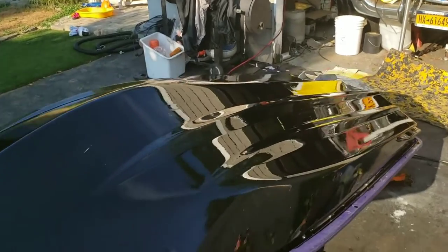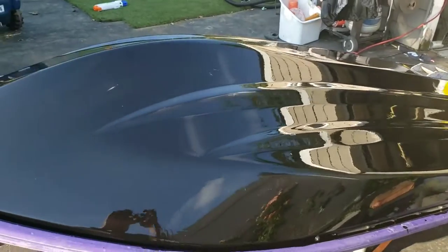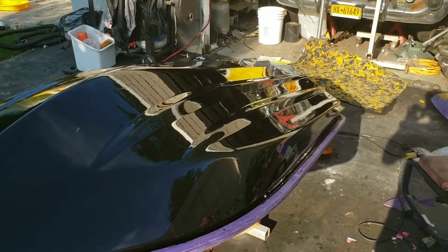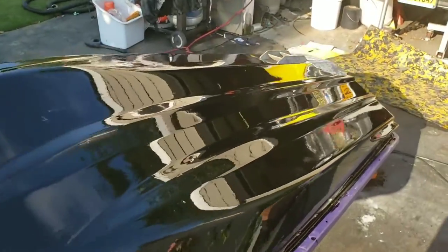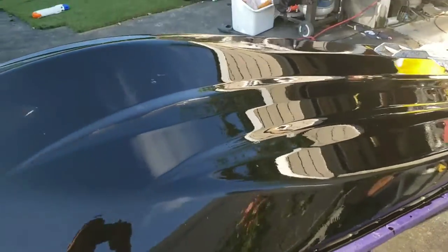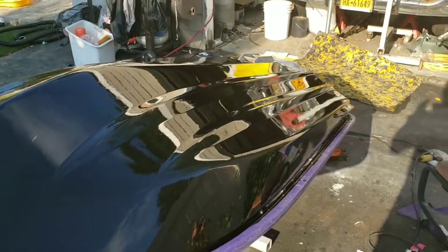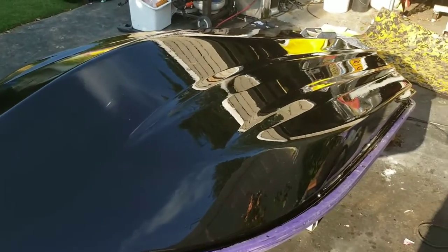After about 20 minutes, you can see this is the first coat so you might see some flaws in it. But for the first coat before wet sanding, I think it did pretty damn good — that's what's so amazing about this stuff. I'm going to continue, probably sand it down, maybe spray it or roll and tip it again. Then we're going to flip it all over, start putting all the graphics on it, and keep on going.